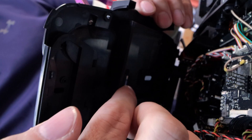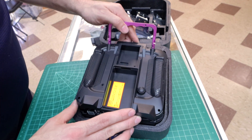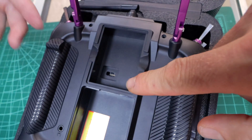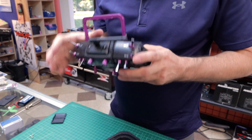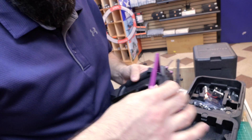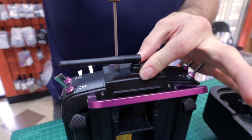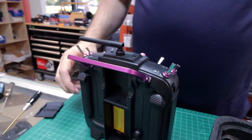On the top side, if you're looking, the pins have to go through here. So when you get it put together, you want to make sure you line it up. This is very important — all jokes aside — because that is the number one thing that people damage. You may not notice it now, but when you go to put in an external module, that's when you notice it. If you bend those pins and they're shorted together and you go to power it up, you can blow out either your motherboard or your multi module. So you've got to be careful — that's honestly the only difficult part of this installation. Just take your time. From there, you're just going to put it back together with the screws. Now we're just putting the side grips on, tightening down the top. You don't want to over-tighten anything here — it is plastic, so just go until it stops. You don't need to over-torque it.